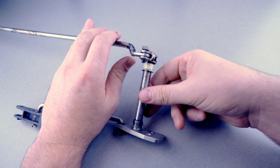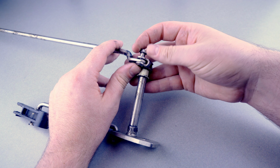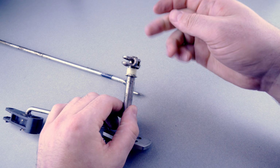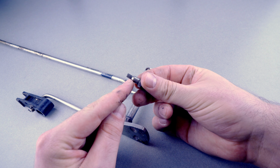The screw really needs to be designed in a way so that there is no thread, so that there's a pin or something that just keeps it inside, because this is deep inside the motor, as it's constantly rumbling and shaking at all times, especially when it's a 2-stroke, this can just fall out. And like I said, I thought I put it in well, but this happened twice. And I had another motor where this piece actually got cross-threaded, so you could never even screw it in all the way, so I had to replace this. However, still, you can see there is a thread.